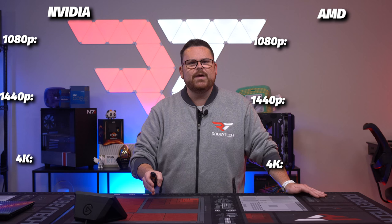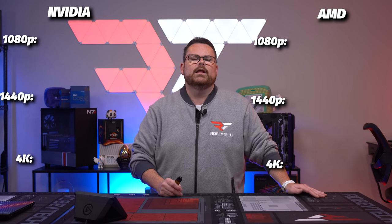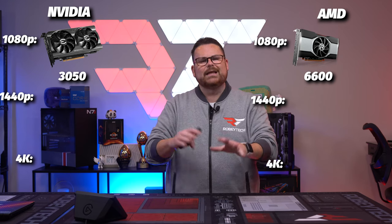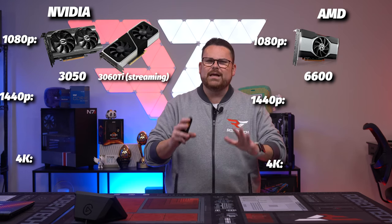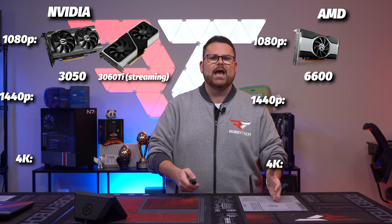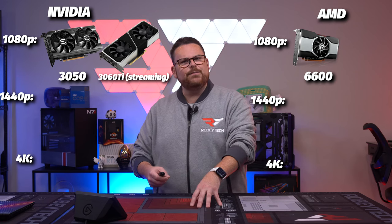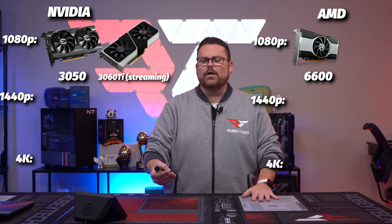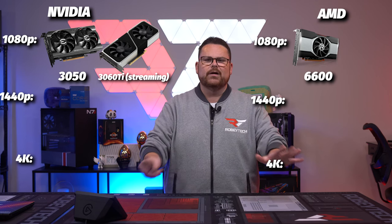Hopefully Team Red, I will be on your side soon — just not right now. But regardless, I will put in our cheat sheet the AMD choice if you want to go Team Red. Here's the list: for 1080p gaming on Team Green, the 3050 and up; on Team Red, the 6600 and up. For 1080p gaming and streaming: 3060 Ti and up — you want to think about 10% loss in frames, which is about the performance difference between a 3060 and a 3060 Ti. For AMD, you're going to be CPU-bound given that we don't have that NVENC answer, so as long as you're using a 5600X or a 12600K, you're going to be absolutely fine.